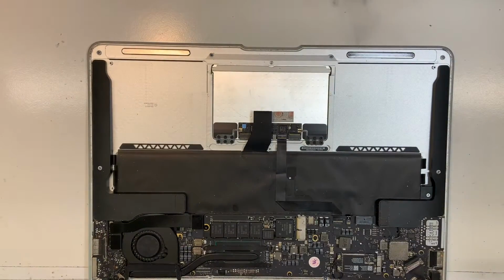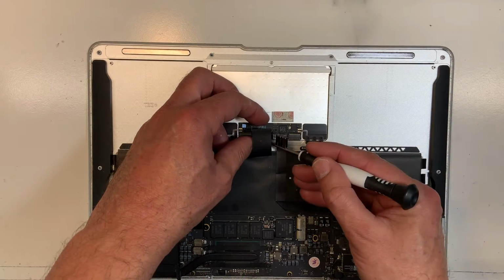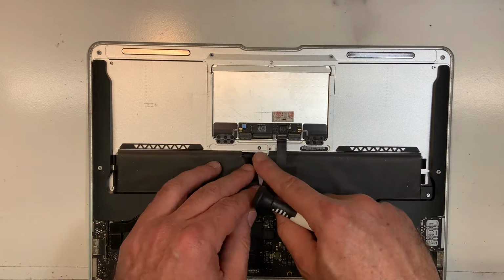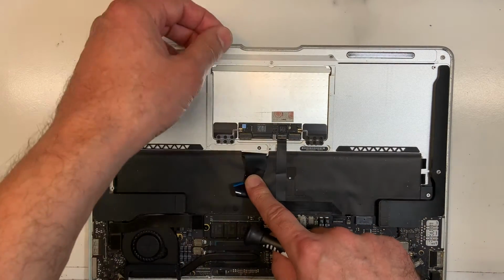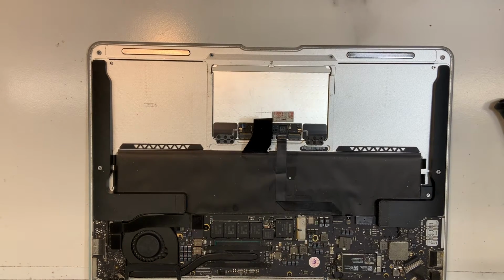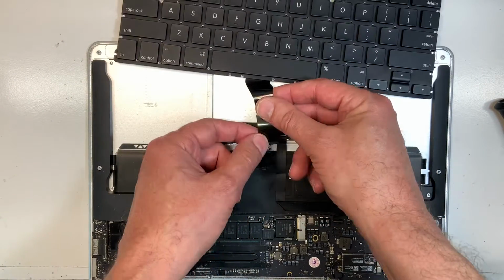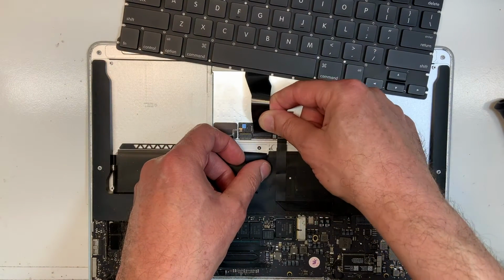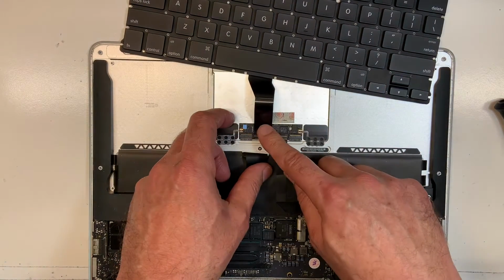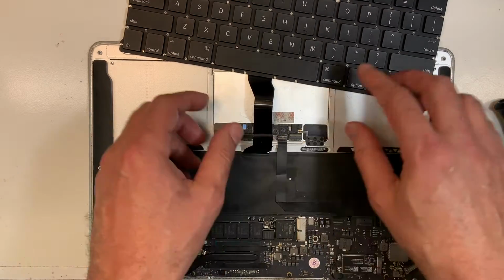So what you have to do, you have to unplug the old keyboard cable. Here you go, that's the trackpad. So you lift this over here and you pull the keyboard out. Then you grab a new keyboard, and you plug it in gently. You don't want to damage anything on the trackpad. Gently. Nothing should fit by force. If something is not coming in easily, there's something wrong.